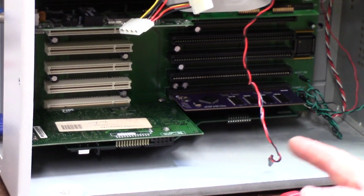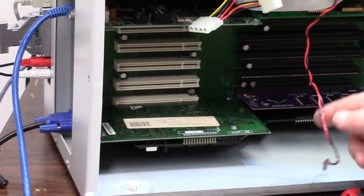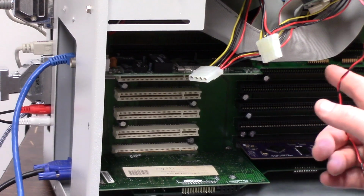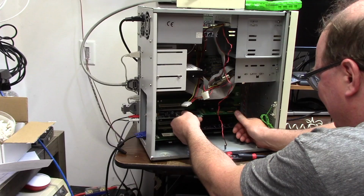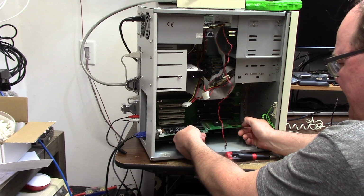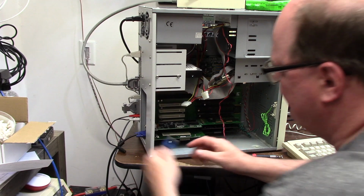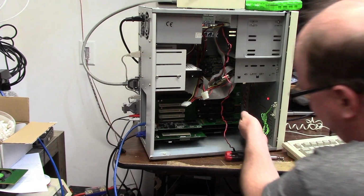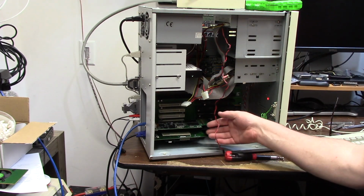Now I have a Gotta Go Fast Live 2 board here. It only works in this slot. If I move it anywhere else, the bus arbitration does not work. I have a Xsurf original behind me. This is a 5-volt ground that it's going to use for a fan. You know what? Let's just go down all the way. Hell with it. It'll just be warm down here. Alright. Hopefully the Xsurf works in that. Yeah, it's pretty warm in there. I'm going to have to get some fan in the front here somehow, some way, shape or form, and blow air across this to cool it.